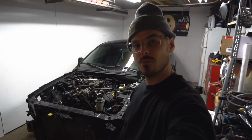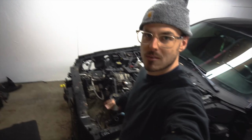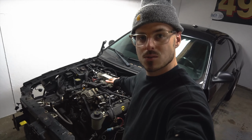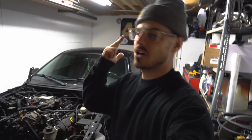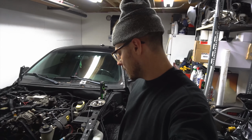I've got the Mustang home now, and we're just working on pulling out some stuff in the engine bay, rads, condensers, disconnecting anything topside so I can lift it up in the air and then get underneath of it and disconnect the shift linkage and exhaust and pull the drive shaft, stuff like that, so we can pull the motor out of it and get it in there. So nothing too terribly exciting going on.